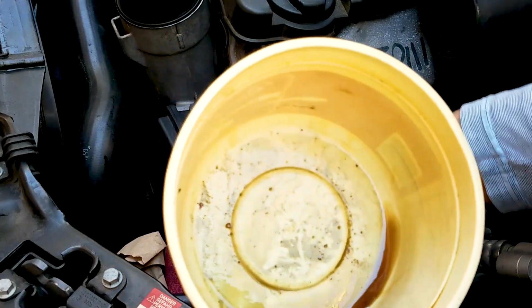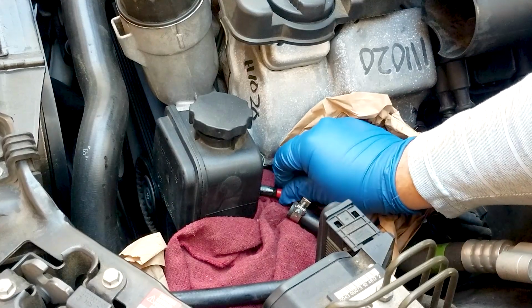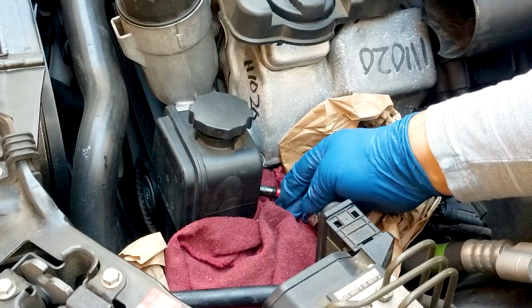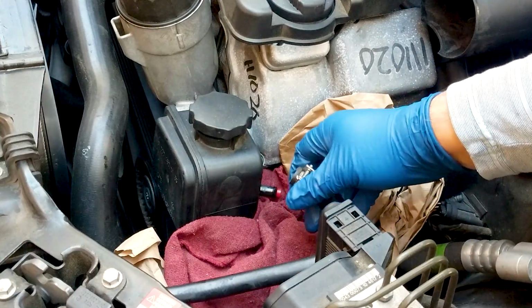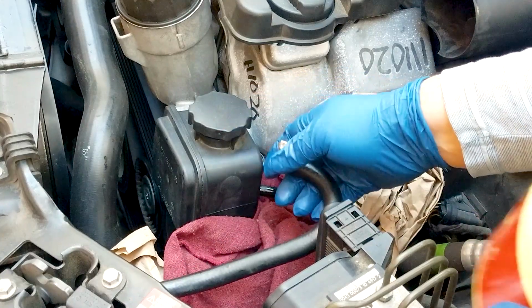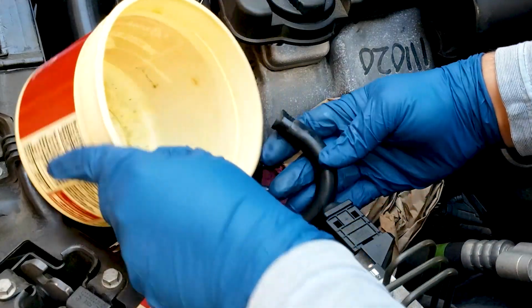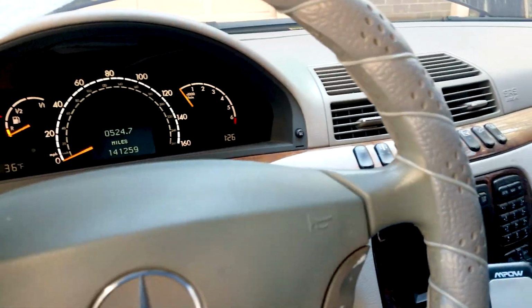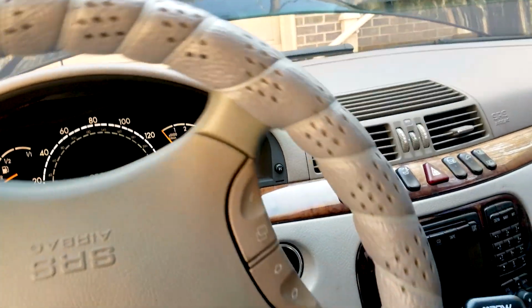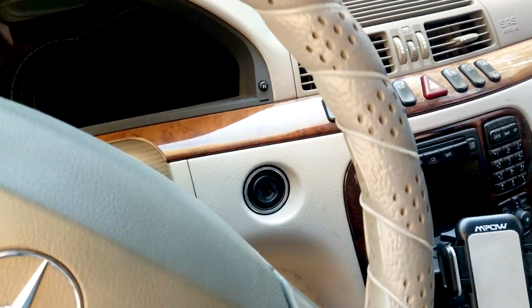And the reason is because I suction all of the oil out. And this is the silicone plug. I've gotten this from Amazon. I think 50 pieces, different sizes and diameters for $11. Comes in handy in many applications. So I highly recommend that you purchase something like that. If you don't have it, that's fine. You can use a catch container there. But actually you will need a plug of some sort so that you can keep filling the tank.